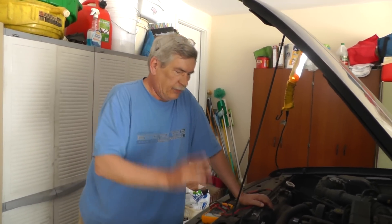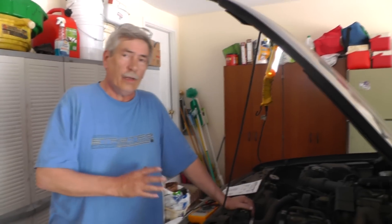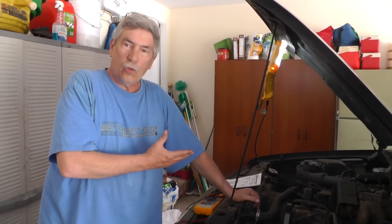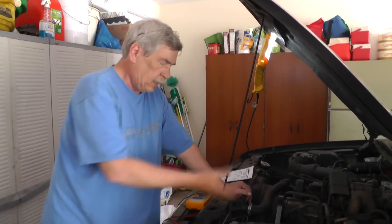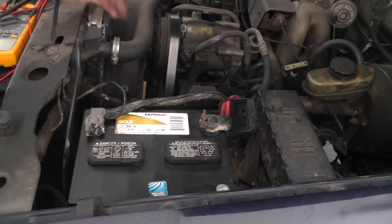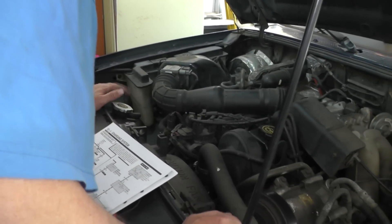Maybe in the next video we'll show the replacement. This vehicle has 291,000 miles — I can't believe we're having these kind of problems with just a few miles on this vehicle. One of the things you want to look at is your battery connections. If you see a lot of corrosion, go ahead and clean that up first — a lot of corrosion means high resistance, which means the battery cannot supply current to the field coil to make the electromagnet so the alternator can make its voltage. So you need to make sure all the connections are good. In my case that wasn't the problem, but I did clean up the connections. Another thing you want to look at is your belt — see if the belt's on there. In my case, that looks fine too.